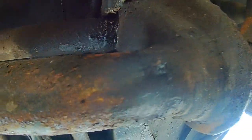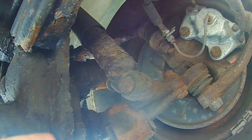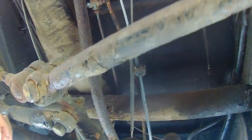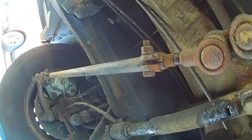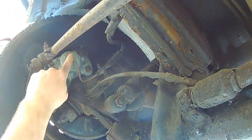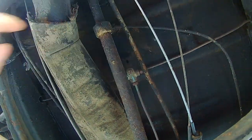To be honest, the rest is coming in quite nicely. There are new calipers on both sides. Shock absorbers are looking a bit worse for wear, so that's something that might need addressed, but no leaking. There's not an awful lot more that gives great concern under here. I'm limited without a ramp so I can only do a quick visual inspection at the moment. Brake pipes, linkage — there are obviously new parts underneath, including a clutch cable.